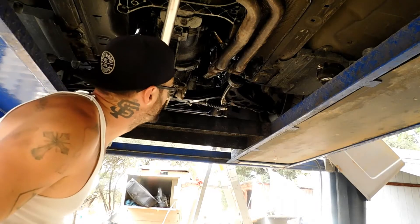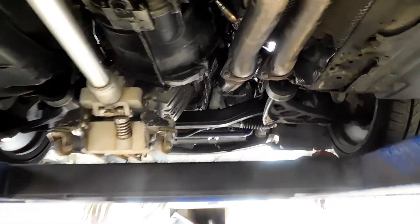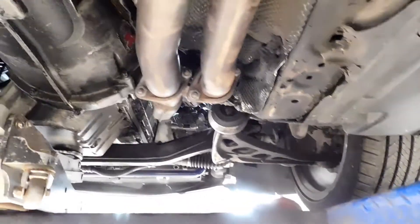We're finally back — that one took a little bit longer than the first one. It might actually be easier to do the second one first rather than the first, because we had to jack up the engine a little bit to get the second one in. The catalytic converter was hidden between the controller and the piping. You can see one, two, three, four studs from down here — that's all you're going to see from underneath.